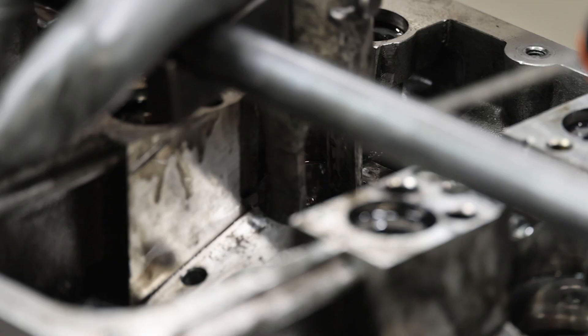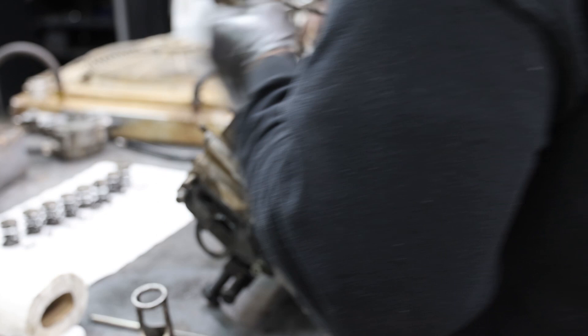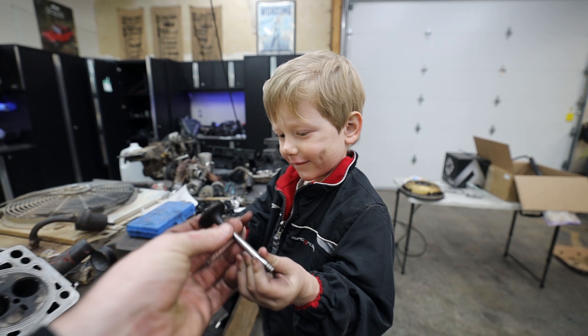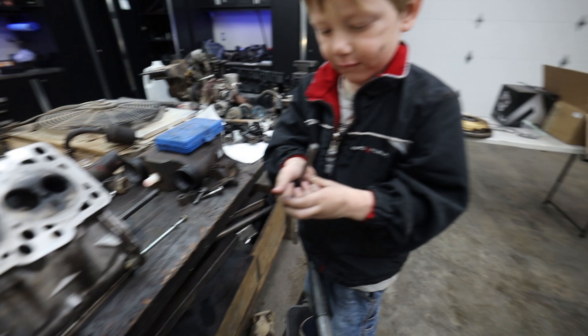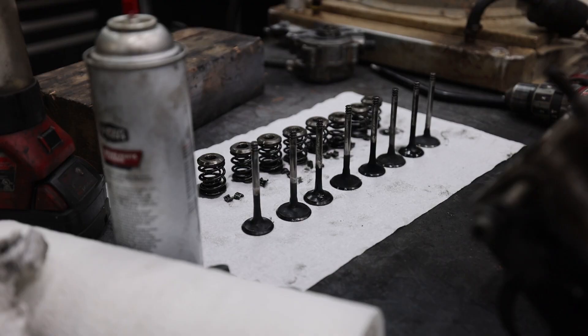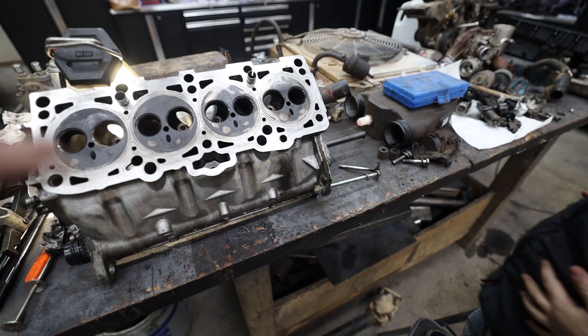After I got the hang of the valve spring compressing tool, I was able to bring Chris over and show him what I was doing — reinforce the use of specialty tools and get him comfortable with this stuff. The valves actually look great. Around the valve looks nice and shiny silver, around the seat looks nice and shiny silver. All of them pulled right out, which is a good sign. If you have one you're trying to pull and you've got to give it some force — like you have to pry it — that's a sign of a bent valve. Right now everything looks really good.